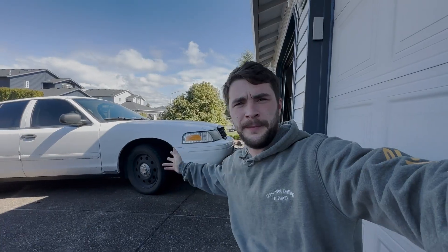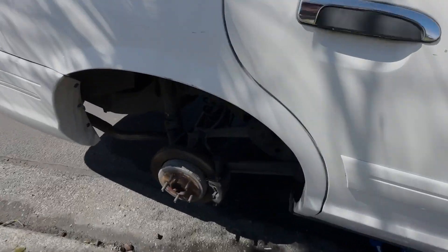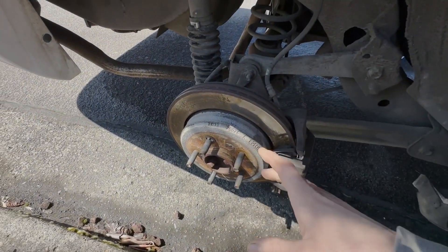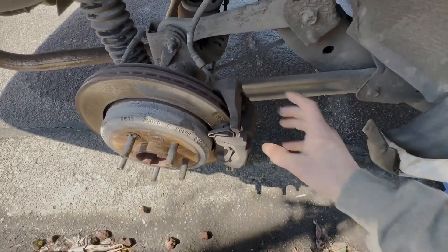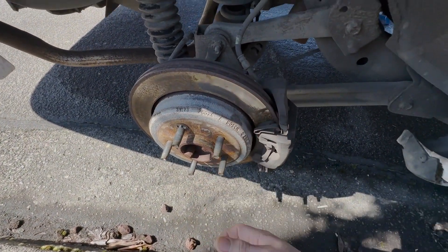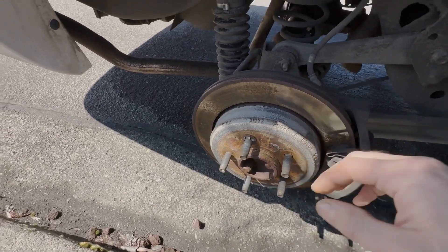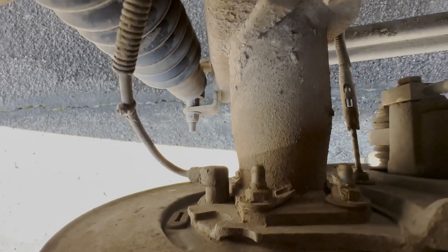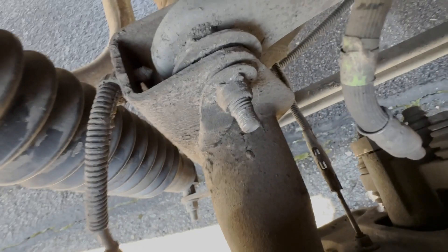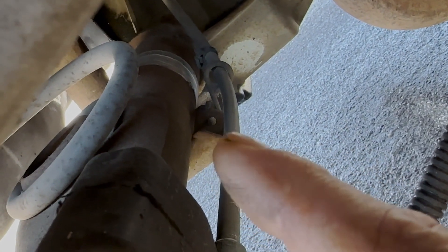Roscoe is all put back together, but I have a spare unit over here on a jack stand so I can go over this one last time real quick and show you all the things you gotta do to take it off. Swapping out this rear end may seem a little daunting, but it's easy. Remove the brake caliper — one bolt here, one bolt below, pop that off. Then pull the rotor off, remove all the e-brake guts on the inside — just some springs and clips. Then go to the back, pull your e-brake line out of the housing, and remove your wheel speed sensor.